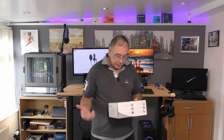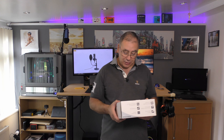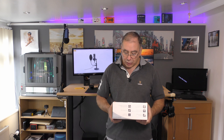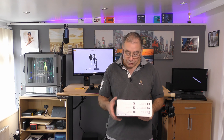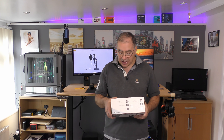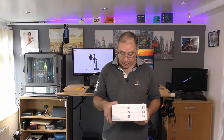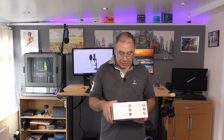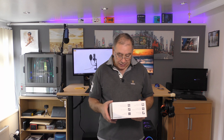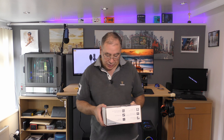The voltage is 5 volts, body weight 220 grams out of the box — quite heavy, but you need that weight to keep it on the desk. Frequency response is 30Hz to 16kHz, sampling rate 96kHz at 24-bit, which is perfect. Maximum SPL is 120 decibels. SNR is 70 decibels. Colour is all black, material is metal, and sensitivity is -38 decibels plus or minus 3 decibels, so it's within a nice range.